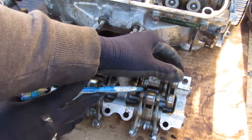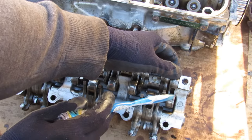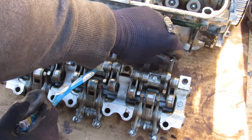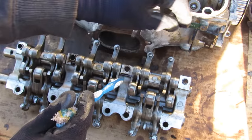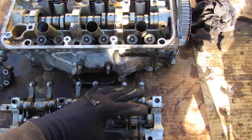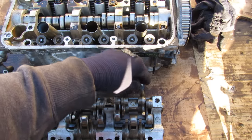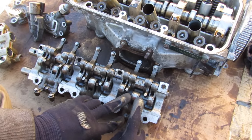I've reassembled this without the pin so these can move independently of each other. Underneath there's a small spring pushing up against this roller arm, which continues to ride the camshaft profile up and down. But because it's now independent from the rocker arm, the exhaust valve has the valve spring pressure pushing it up — the exhaust valve is always trying to stay closed — while the roller arm is just wasting time moving back and forth against the camshaft. Therefore the exhaust valve is completely disabled and forced closed by its valve spring pressure. There's also a flat spot on the camshaft here — no lobe — so the valve won't move up and down.